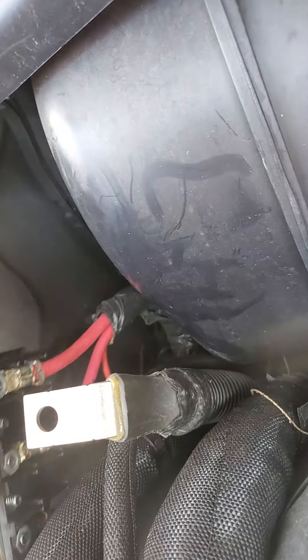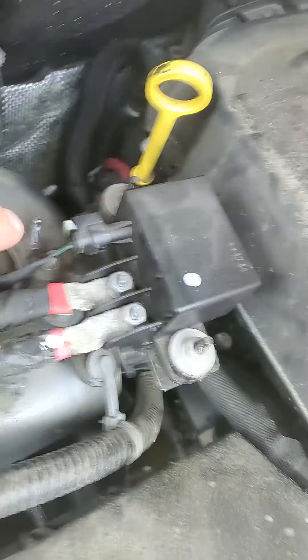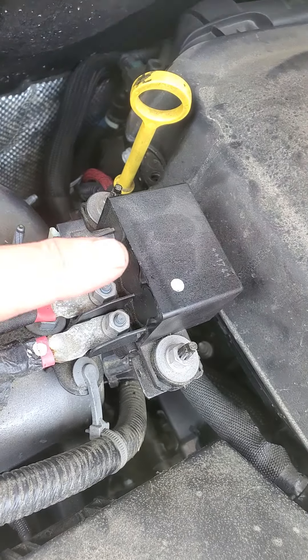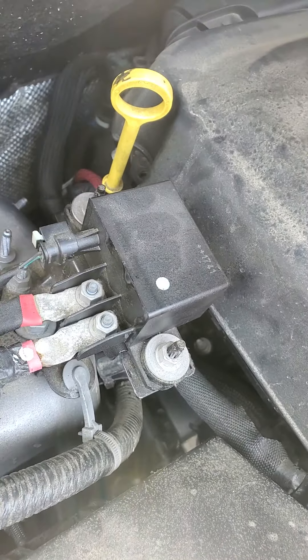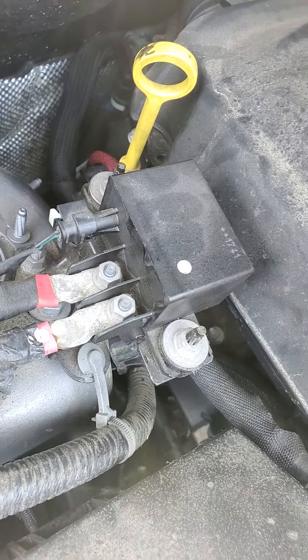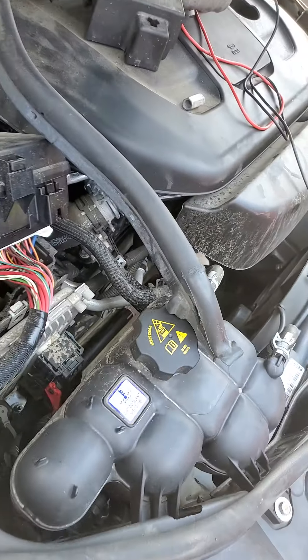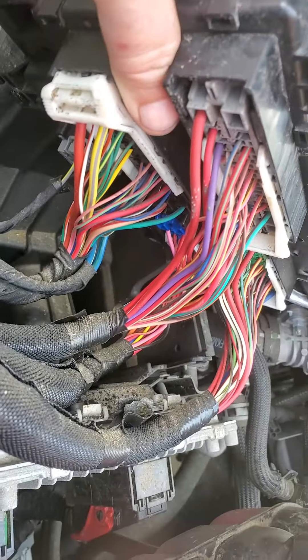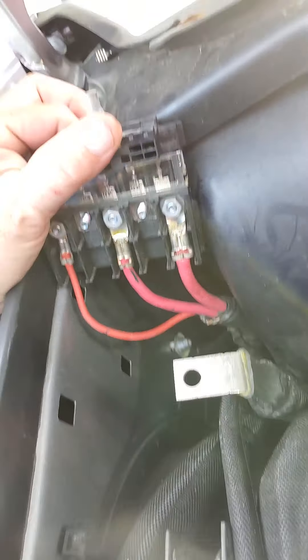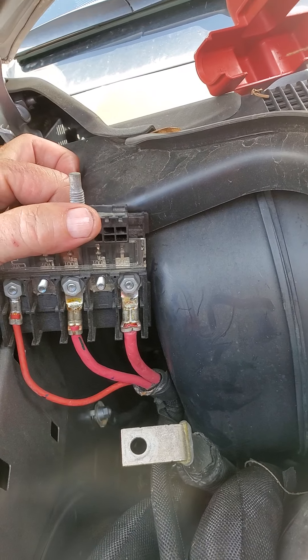I measured my electricity — coming up I had 12.6V here, but only 4 volts at the auxiliary battery side, so I knew there was a problem. I looked at the wiring diagram — it's called Fuse 1 on the diagram. I looked through all the fuses in the main fuse box, tested everything — nothing. Then I came over here and found this location from a YouTube video about something completely different.